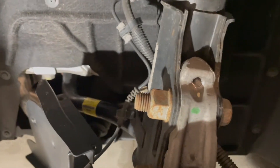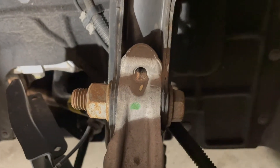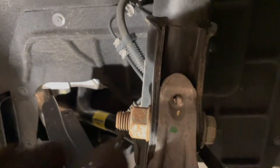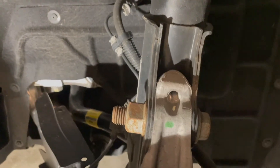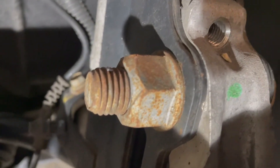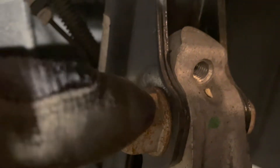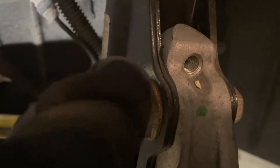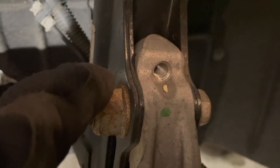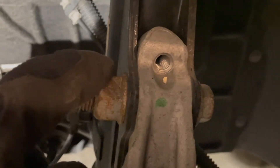I'm going to take a look at the bolts to adjust the camber — you've got the upper bolts and then the lower bolts. Really, the movement is going to happen up here at the top. You can see where the bolt sits now, and we're going to push this bolt back just a little bit. It doesn't seem like much, but when you put the wheel back on you'll definitely notice a difference.